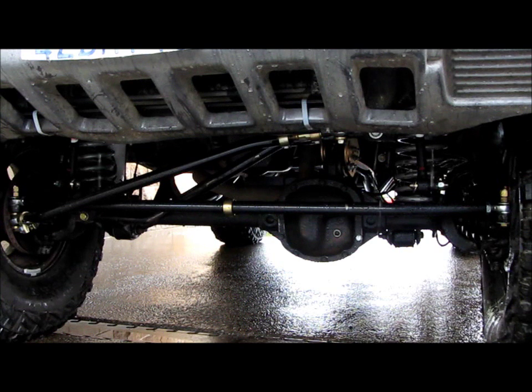That ended up being a combination of a couple things. If your steering wheel is not centering itself after a U-turn, take a look at your front axle. If your front axle is leaned far forward, meaning the top of the differential cover is leaning way forward compared to the bottom, that's your caster adjustment. And if your caster's too far forward, the wheel's not going to center and it's going to feel really weird as far as the steering.